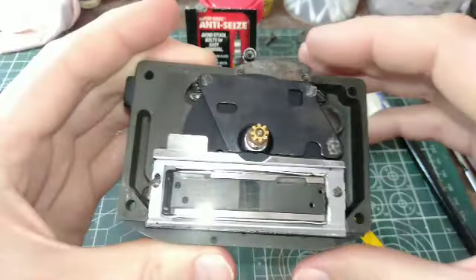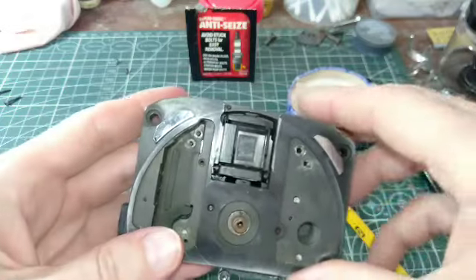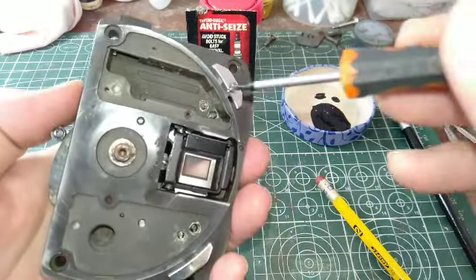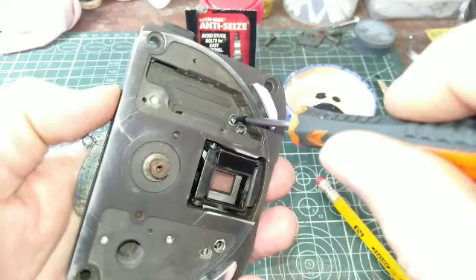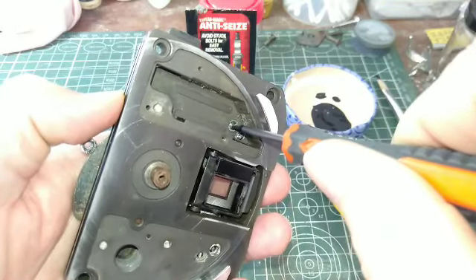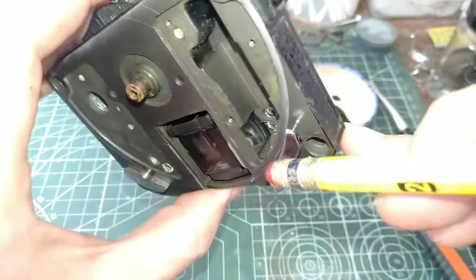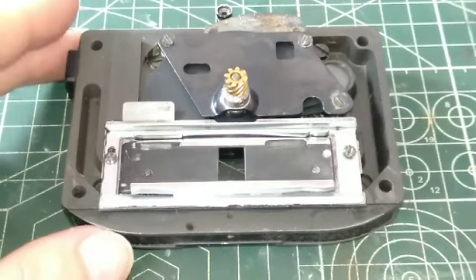Be careful not to let this fall out — you can hold it with your fingers. We're going to start applying the screws. I'll show you what it's like to put the screws in, especially through the back of the inside of the transport prism housing — the screws go in this way. Remember, not too tight, and I've got some anti-seize in there. Remember not to put too much in this area, as any excess could squirt down in there and get on your prisms — those two prisms are thin and sandwiched together. I just center this up right here, but it's really centered anyway.